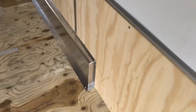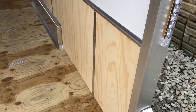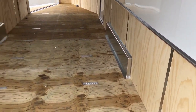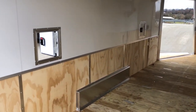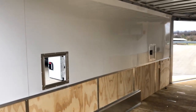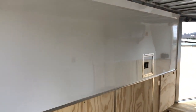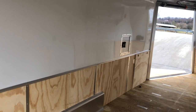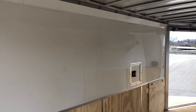On a seven and a half wide, the fender pretty much lines up with about the corner posts of your door. You've got about a two inch reveal on either side, which gives you pretty much the same room inside as anything you can fit through the door. On this one we've done an aluminum sport wall. You can either get an open face wall, vinyl, or aluminum — aluminum is the nicest of the three. It does reflect a lot of light and gives you a very nice clean look. This trailer is 6'6" inside, so you're going to have about two feet of three-quarter ply kick plate and then about four feet of your aluminum sport wall.